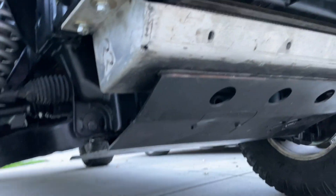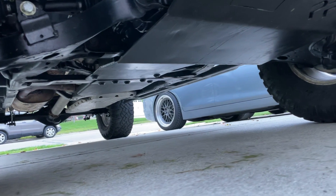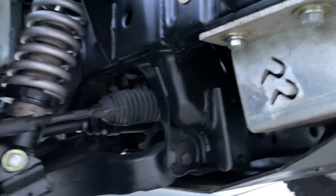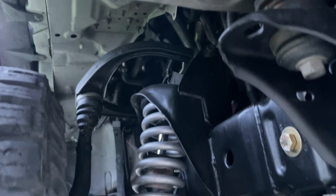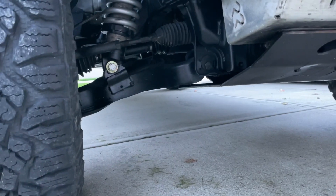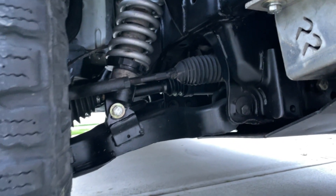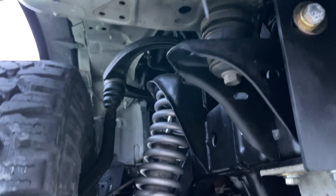Underneath you can see it is fully armored with PNP stuff — it's a mix of aluminum and steel all the way back. Tons of protection underneath the truck, which is awesome. He recently went through the whole truck and cleaned everything up. He's basically had it for about a year and he's only done wheeling pretty much in Moab with it. So it's still super clean under here. It's got Radflo two-and-a-half-inch lift coils in the front, SPC upper control arms, and Titan brakes and lines as well — tons of space in there. This is just what's so cool about these Titan-swap trucks: you basically take all the components in the front from a full-size Nissan Titan and they bolt up to the Frontier. So now you've got a wider track, heftier components, more beefy stuff — and it should take a lot more abuse than a stock Frontier suspension would.